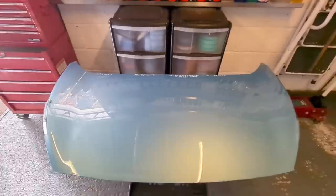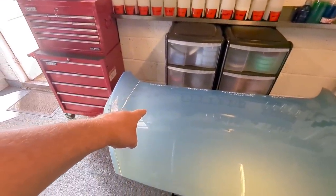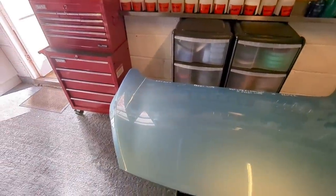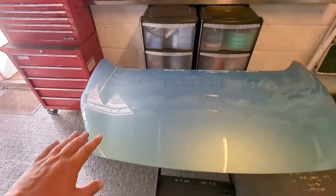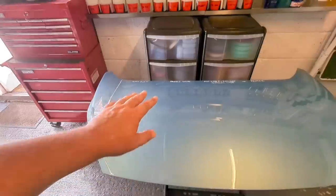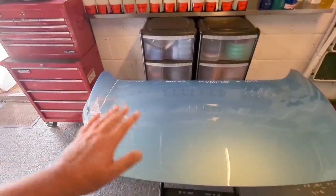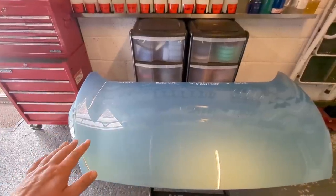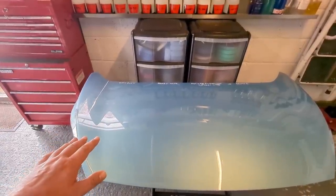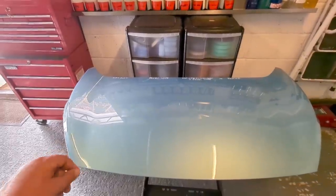But what I think I should see, let's just pan out, is I think I should see this section here, the coating should degrade quicker because it hasn't bonded. It's hard to imagine what's going on, but you've got like a micron of film formed over here, and that film sits on top of it, and as you wash it, you're abrading against it. If it hasn't bonded as well, that coating's going to come away and erode away quicker, perhaps.